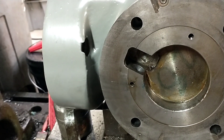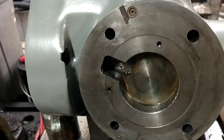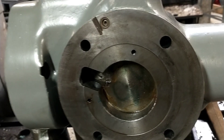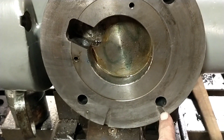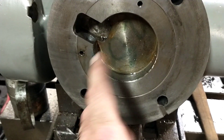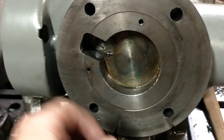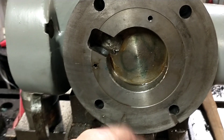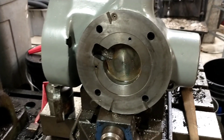We're kind of shocked by that. We've never run into such a gross mismachined part by Bridgeport. But what's interesting is that this one was originally on a duplicator and they had doweled it in place — I believe it didn't have a gear in it. So apparently even right at Bridgeport, they knew that it wasn't right. It was probably on the reject pile and they dealt with it by just putting it in an application where they didn't think you'd ever need that.